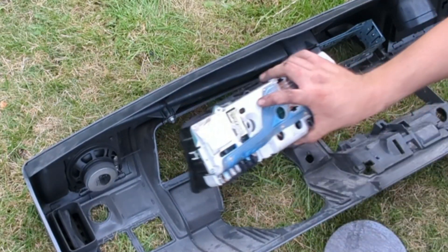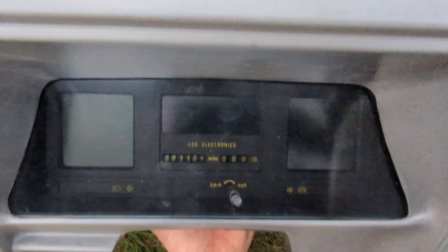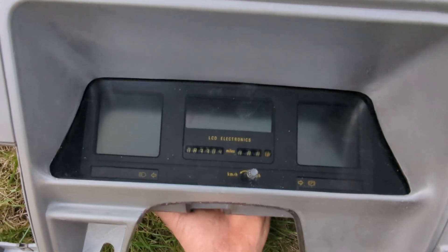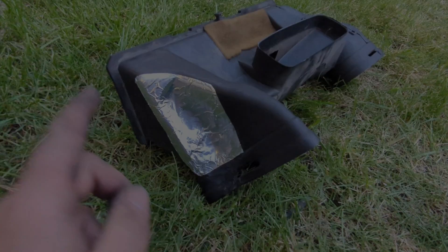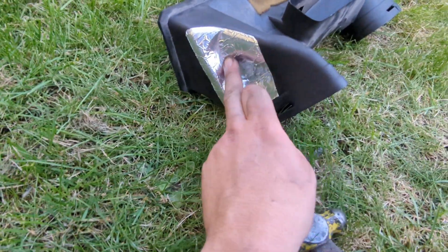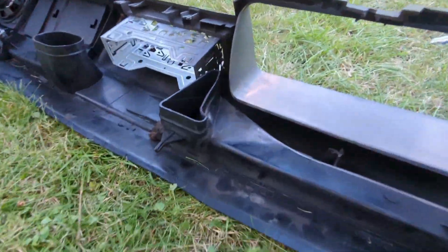I've trimmed the lugs off the top of the dash as well. The edges look really good — I'm really happy with the cut-out, it looks really nice. I just need to hope it stays in position when bolted up; if not I'll make some kind of bracket. I've just heated this bit of the top duct and stretched it with heat and a ball-peen hammer — got it hot, pushed it in, got it hot, pushed it in. It just started to split slightly so I'll put some foil ducting tape on it. That clears the dash well enough.